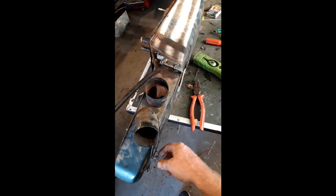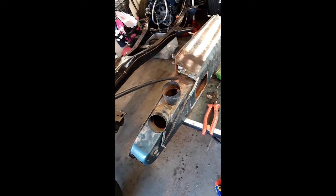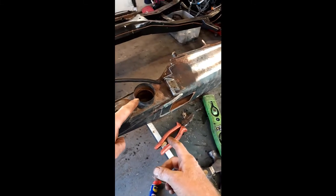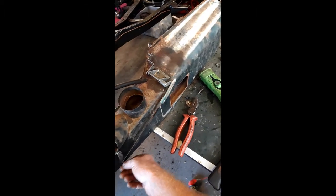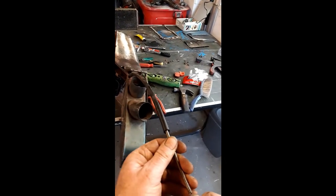Now if you have it down closed, obviously this can move independently, as we can see. So if you have that down closed and you're directing all the air up into the vent, then when you operate this, that opens it slightly, allowing air to go to the windscreen and down through the footwell. The reason for that I don't know, but that's what it does. That's why this moves independently, but will always open when this cable is operated.